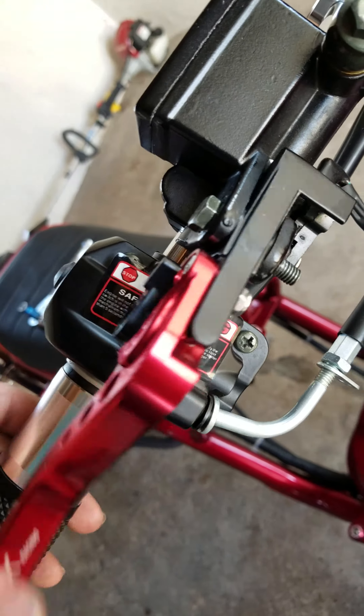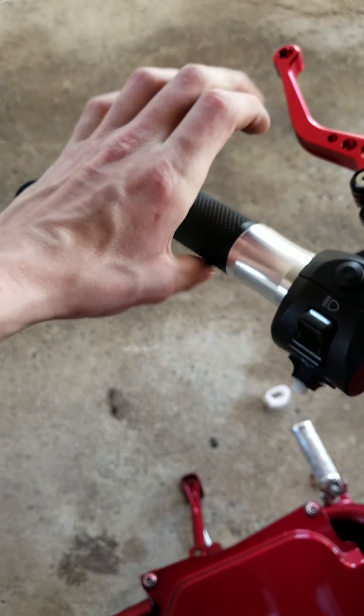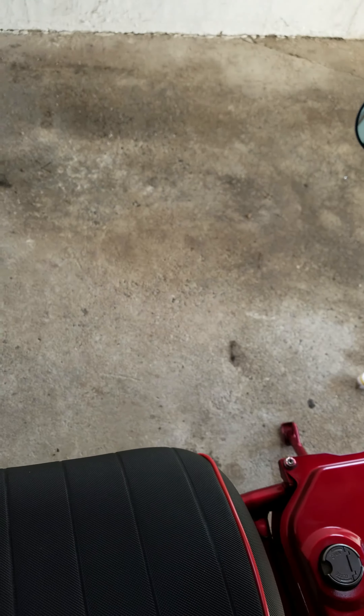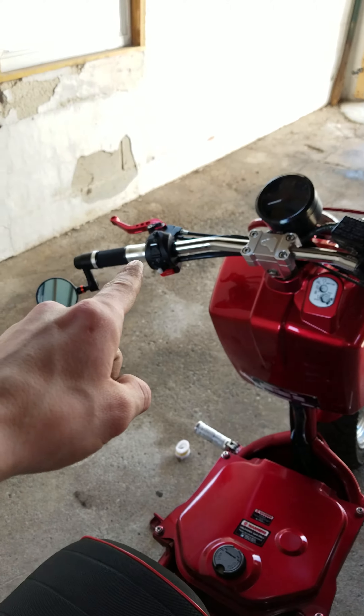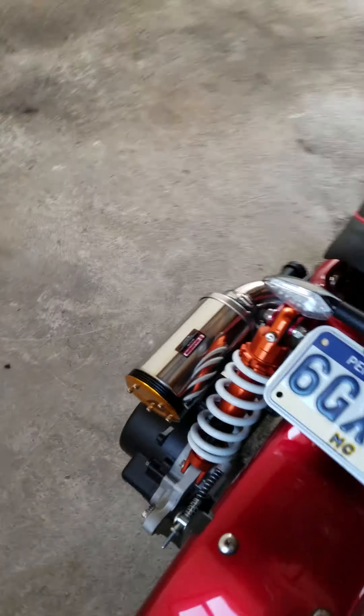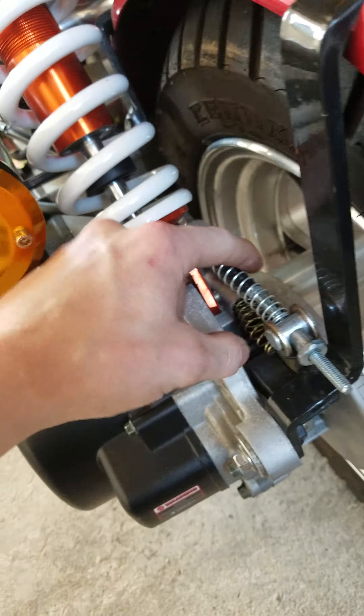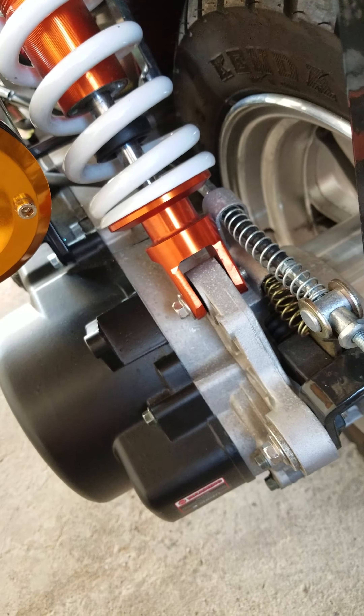That's on. I'm going to max these things out — this one stops before I even touch the bars. This one will probably be at the max setting or setting five; it has six settings so five would be the sweet spot. This thing only has 300 miles on it so it's definitely got some wearing in to do. If you max that lever all the way out to six and it's still not slowing it down or stopping it immediately, you'd have to come back to this adjustment nut and tighten it in to basically pull it closer so it's more sensitive.